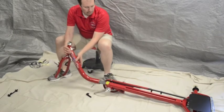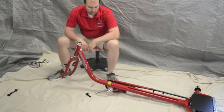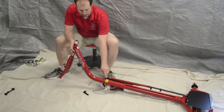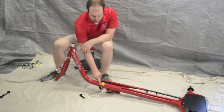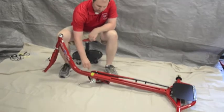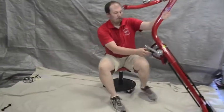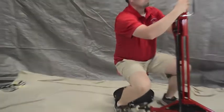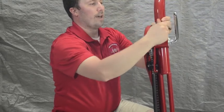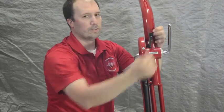With it set up like this, make sure that the black back plate is upright, which means the frame is correctly upright. The frame will go into this just like it's ready to accept the wheel — those two slide in together. Sometimes you have to give a little encouragement with the rubber hammer to slide it forward a little bit; sometimes the paint gets caught up, but usually they go in just fine. Then take your pin and your frame knob — the pin goes in from above and usually goes right in, sometimes needing a little encouragement with the rubber mallet. The bottom frame knob goes in from below.